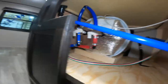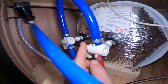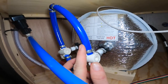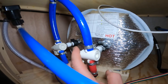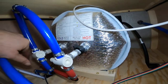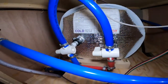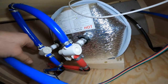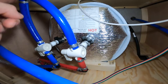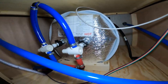The last stop on the tour is the inside portion of your hot water tank. You can see we have two valves here. Those valves are utilized in order to switch you between winterization mode — bypassing the water heater — and summer mode. In summer mode, we want the water heater in use, so we direct these valves so both are pointing towards the tank, meaning water flows in and flows out. If we're winterizing, we do the opposite so that water flows around and bypasses the hot water tank, because we don't need to fill your water tank full of antifreeze.